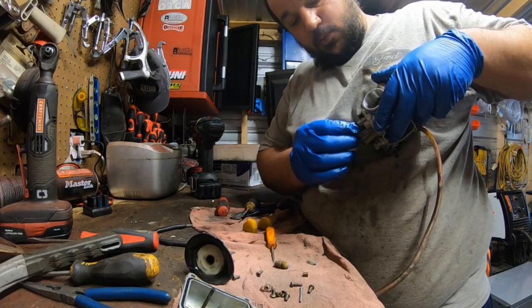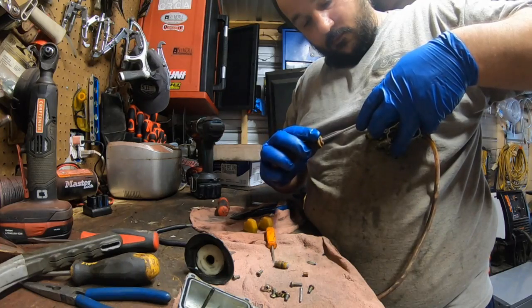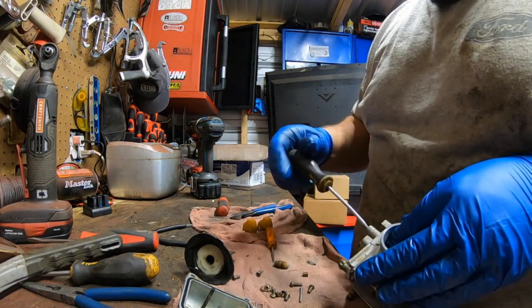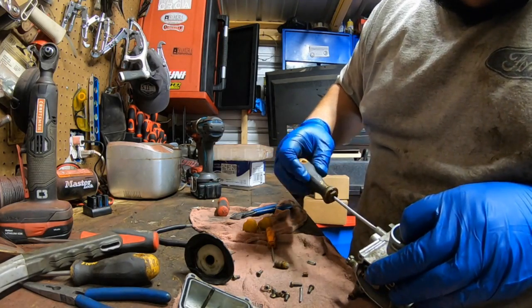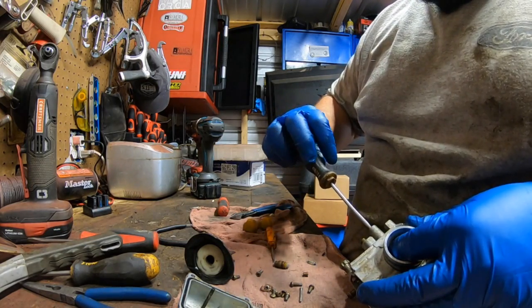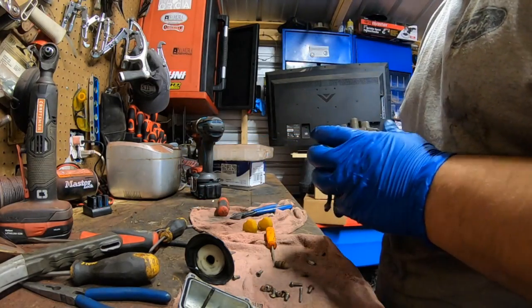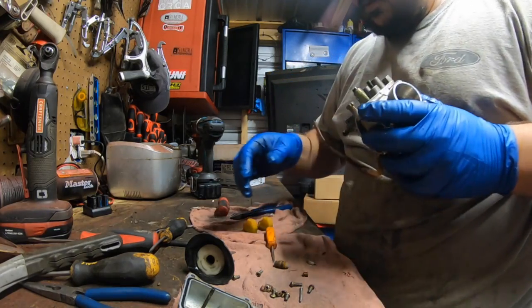Carburetor upside down, thread it in. And the mixture screw, they will break it sometimes if you go too tight. Don't overtighten them. Go ahead and seat it nice and easy. Okay, here you go, half, one, half. We're gonna go 1.5 out on this. We are in South Carolina, so we're pretty much sea level where we are.